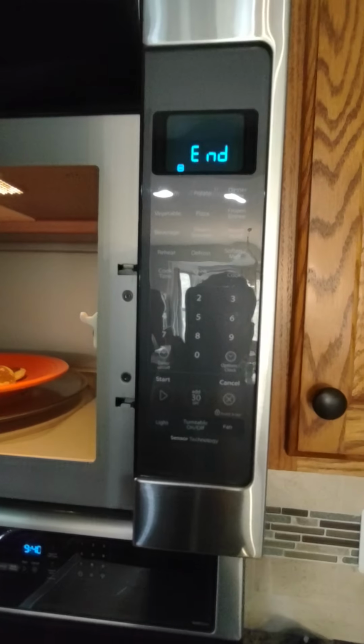If not, this can come loose, and just push it, just kind of with your hands, pull it back down in there a little bit. Someone's slamming the door, something gets caught, or for some reason, that can be the issue. It can be popped out just a tiny smidge, and it's got to contact with your microwave. Or maybe you use something to clean along here that's not providing a good contact. So if that's loose, or any of these little sensors are dirty, it's going to give you that issue, and hopefully that helps you out.